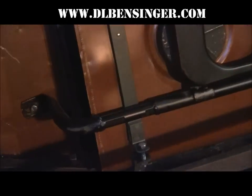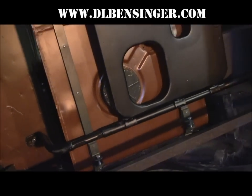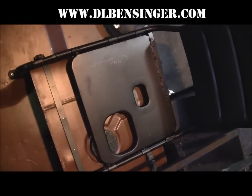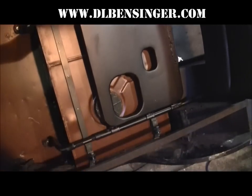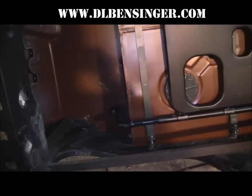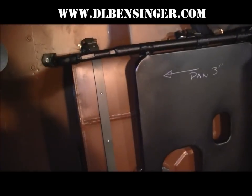You can see where the customer had extended the seat frame in the past in order to get more room behind the steering wheel. So what we'll do there is, now that we tried it out, fitted it, and know we've got a problem, we'll move the seat pan forward 3 inches later on before we go to install it. But at least we've found an issue now before getting this all welded in. Now, in the case of that seat frame, it really wouldn't have made any difference in the floor anyway, but you want to make sure that your gas tank fits in properly.